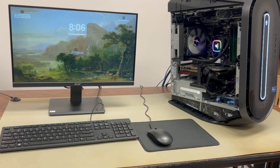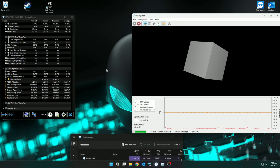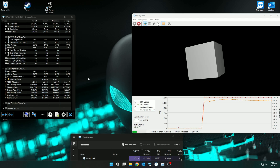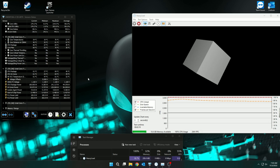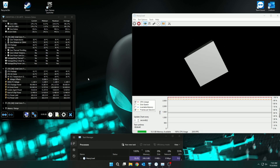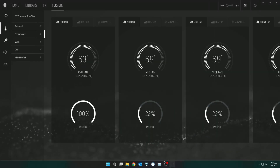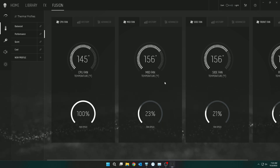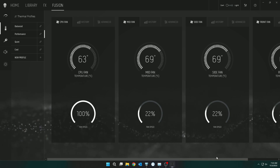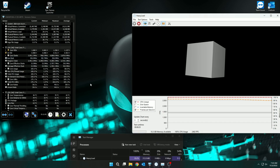Now for the results of all our hard work — time to see if it actually made a difference. Running a test with both CPU and GPU under full load, even with 100% CPU usage — under which you would never normally run the computer — it stays around 70 degrees Celsius, well within safe operating temperature and far better than where we started. One thing to note: in the Alienware Control Center, the CPU fan reading will always show 100% even under no load, since the fans are not directly plugged into the motherboard. Thank you all for watching — I'll leave links in the description to everything I used, and hopefully you can solve your Alienware heating problems too.